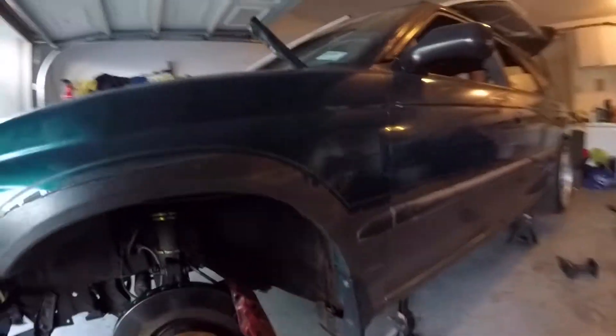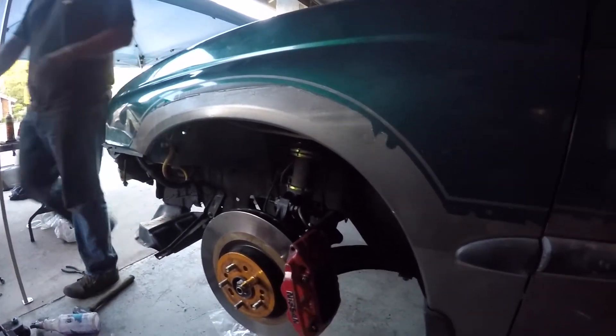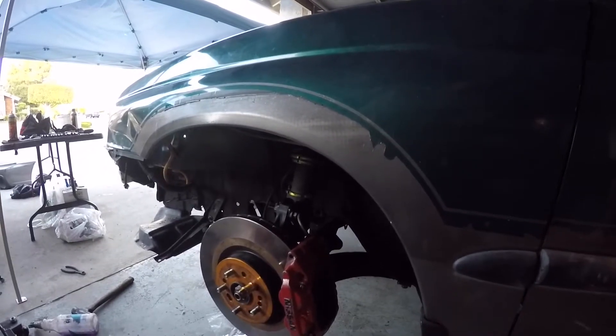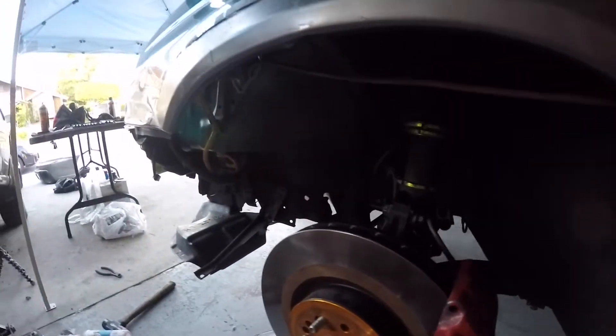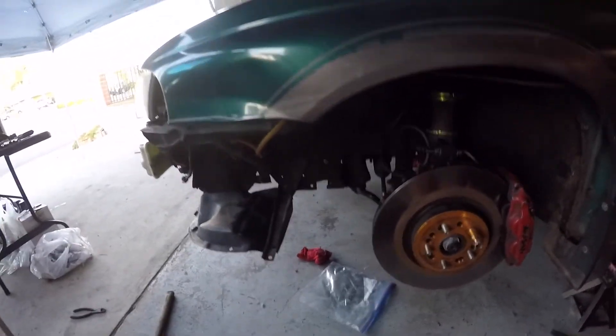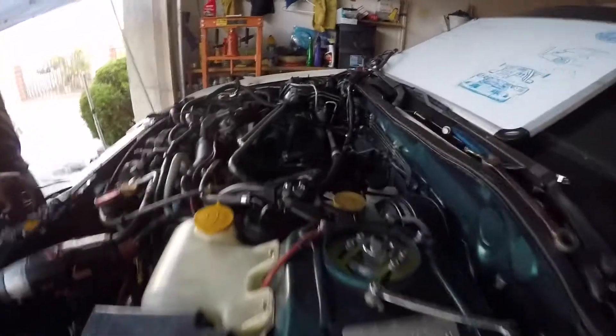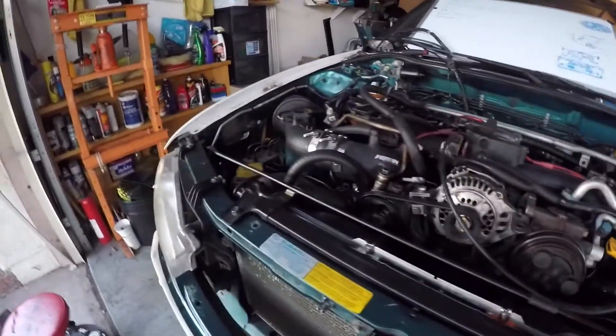Transmission's in. Wheels are off; the car's on jack stands because we left the axles in. In order to get the trans in without the axles being in the way, we needed to undo the lower coilover bolts and camber bolts so we could swing the assembly down and drop it out, then put everything back together. We still need to reconnect the brake lines — the car had no brakes for the last two weeks. The clutch master cylinder's in with the slave cylinder and it's bled. Heater hoses and fuel lines are done; we put the radiator in with radiator hoses and connectors.